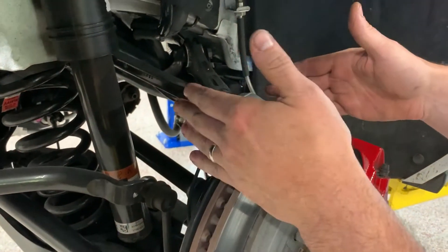So that's the links here in a nutshell and my plan moving forward. I'll replace these trailing arms and I've got these toe links already replaced. I'm also going to go over in my next video the BMR lockout kit for the subframe. What that does is help eliminate shifting in the subframe — or the rear cradle as people call it. We'll go over the bits and pieces when we get to installing that. Thanks for watching.